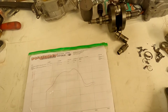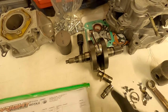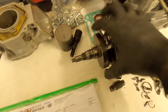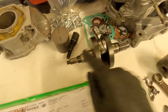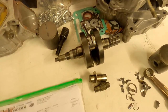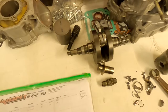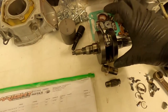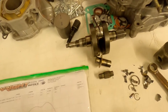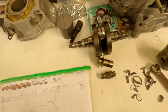The bottom end is a bit more complex, but you can buy parts cheaply. What I did was have the service centre local to me fit the rod, because a special tool is needed to press the pin in and out. When you have the rod fitted, the two sides of the crankshaft may be misaligned, which can cause vibrations or lock up the engine. They charge me £40 in labour to balance and align the crank. So you can take your new rod to a service centre or any two-stroke shop with a crankshaft alignment kit, get them to align it, and then assemble the engine yourself.